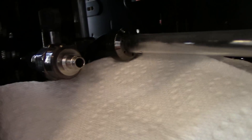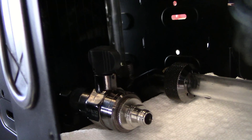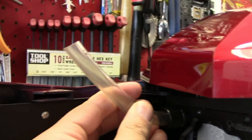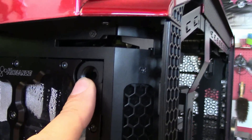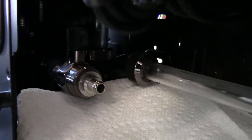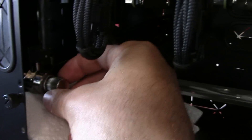When filling the loop, you need to open the drain valve — remove the cap as shown here, with the T-handle aligned with the pipe, and place some absorbent towel or rag right here. Then remove the two caps in the front reservoir and take a compression fitting with some tubing, fasten it in, and use a funnel to fill the loop with distilled water. Having the cap up here will help allow air to escape. Fill until you see water come out of the drain valve, then close the drain valve. You're doing this to allow air out — otherwise it's going to take a long time to fill the loop.